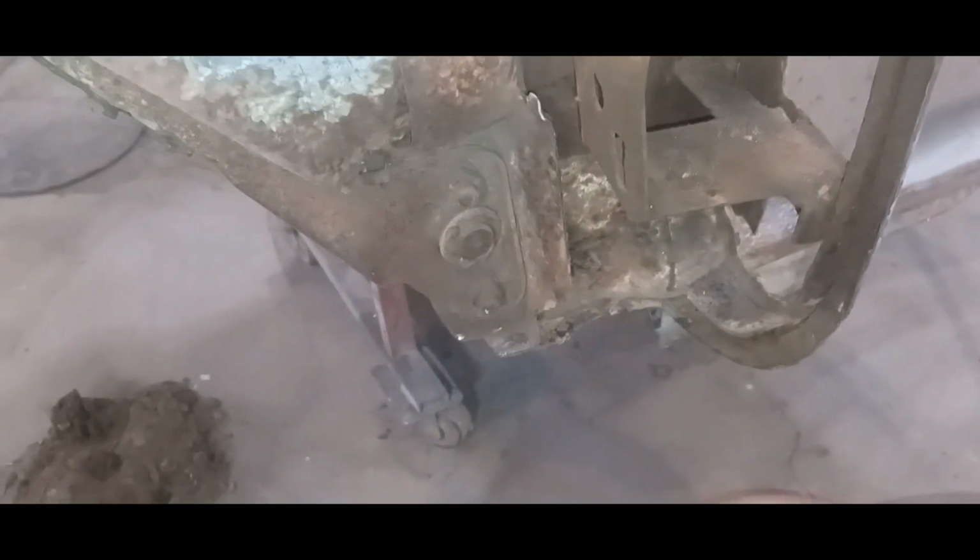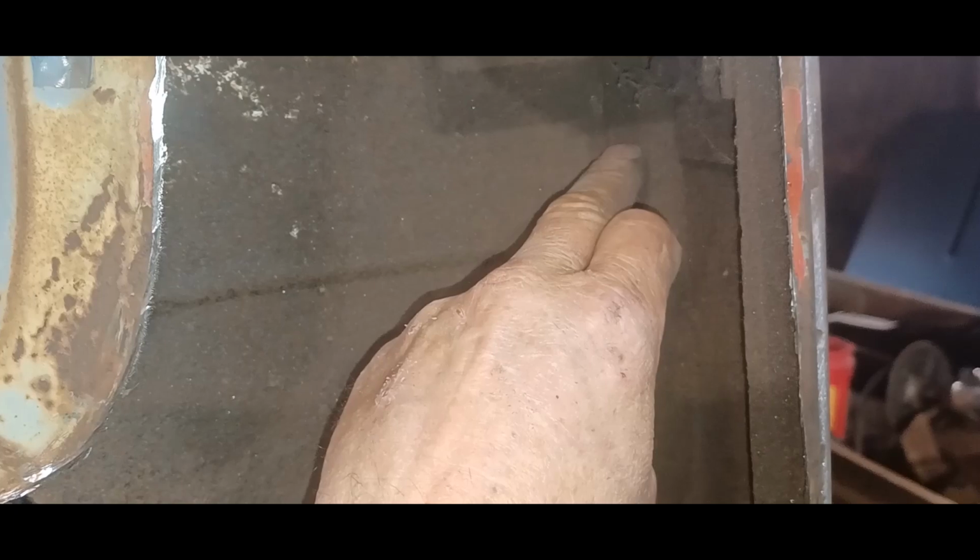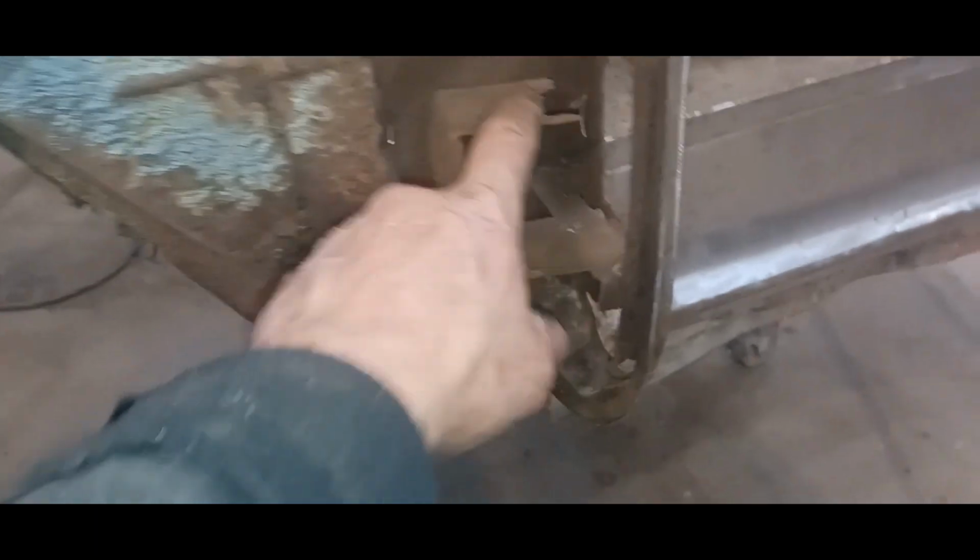And cut this out of here, trim it up nice so that the new one fits. And then I'm going to mark the line here. So there we go, the dotted line. Cut this piece out so I can get at the pan, or the toe kick panel, and cut it above the rust, wherever the rust stops, put the new panel in, and then I've got something to brace this with.